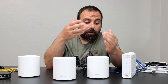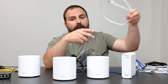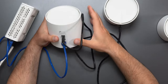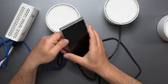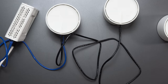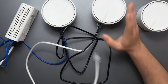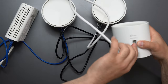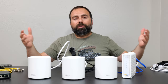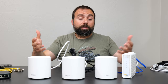The cable also matters. In this demonstration these happen to be Cat5e, but for my main network I use Cat7 and Cat8 cables, which can handle up to 10 gigabit speeds. Some Cat6 cables can also handle up to 10 Gbps. Once you set this up, near this node or two or three rooms away, you'll get full speeds — it doesn't matter where you are. To add a third node, just pick any remaining port on the second node, connect it, and if you've positioned the nodes ideally in your home — not too close to each other — no matter where you go in a normal home, you'll get very good speeds and coverage. That's the beauty of a mesh system.